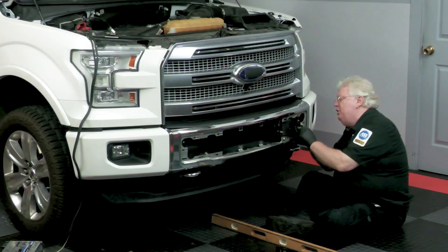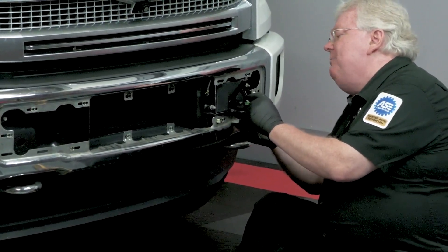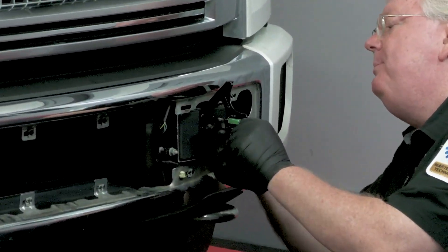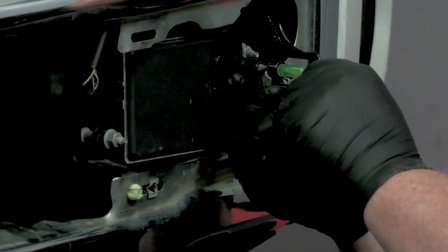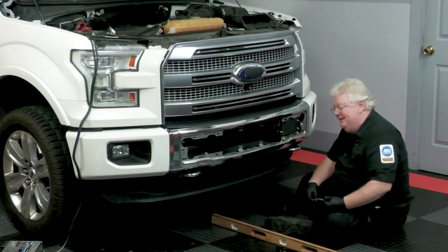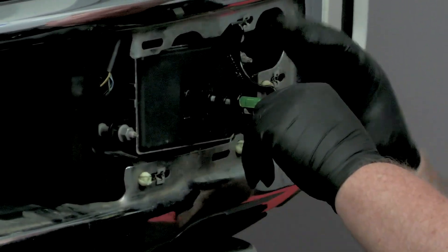What we're going to do is put this right up to the radar unit and check in a couple spots. If you look at the very top we're okay, but at the bottom it looks like maybe there's a little bit of warpage. It's actually pretty far off level no matter where you measure it on the face of the radar sensor. So we'll go ahead and turn these nuts — just like you're adjusting a headlight — except instead of bubbles on the headlight you've got the bubble here on your level, and you're going to adjust it to its vertical level.